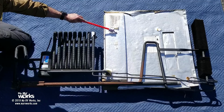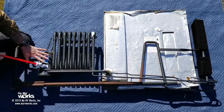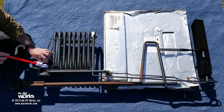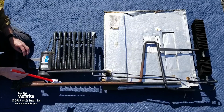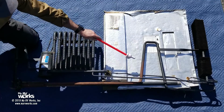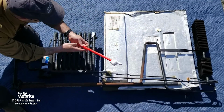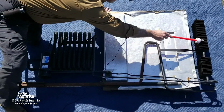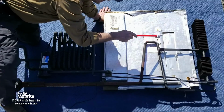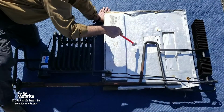Now, I'm about to flip this thing over as well. But so, a little bit of pieces. This vessel here is the absorption vessel or the leveling vessel, okay? This is going to be your boiler here. This is your rectifier in this area. Up in the top, the fins up here, this is your condenser, okay? Like I said, I've got one of these all taken apart and we're going to show you that, but just pointing out some areas.